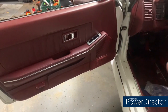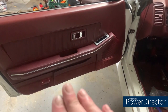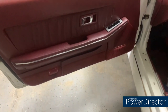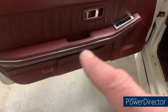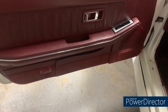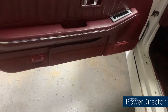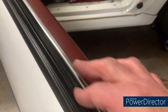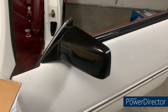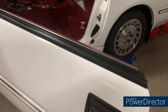Door and mirror are back together. On the door panel I fixed the elastic down the bottom — put a new piece in, stitched it in, and tied it off at the back so it's holding that map pocket tight. I fixed up the chrome where it was wearing off using a quarter-inch chrome vinyl tape that fit over quite well — definitely looks better than the whole area that was black and discolored. We've tidied up the top the best we could, cleaned all the little grooves, and refinished the mirror — it's come up decently, quite pleased with that.